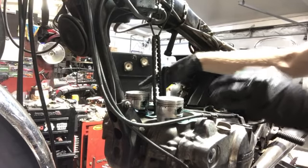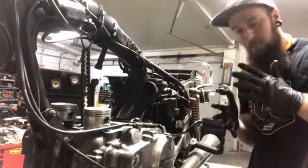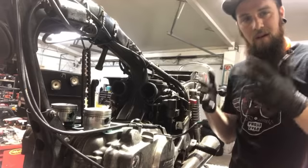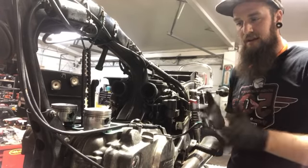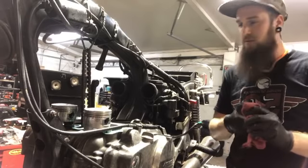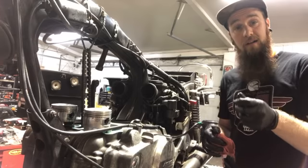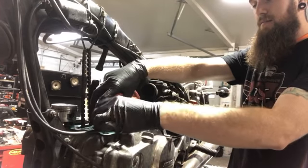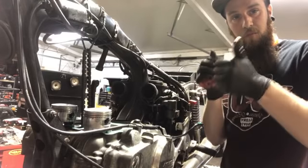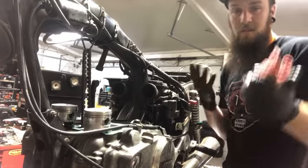One thing that you guys need to know about dowel pins, interesting fact, is that they actually keep the motor from actually twisting, because as you're revving it up and it's getting hot, everything's kind of moving and doing all kinds of crazy stuff. The dowel pins are not just guides for the gasket. They're actually there to keep the structure of the cylinder as close to square as possible. On race motors, like high-end, top-of-the-line, turbocharged race motors, they'll actually use solid dowels. And on a lot of the newer bikes, we're also finding solid dowels. A solid dowel meaning this is a dowel pin, right? They'll use a solid one. Now on the older ones, they had hollow dowels because a lot of times they were shooting oil up through there. But needless to say, the solid dowel is a lot stronger piece of metal, obviously. It's not going to allow it to flex or anything. And yeah, just food for thought.